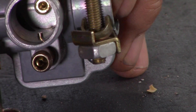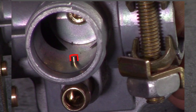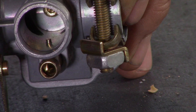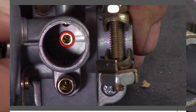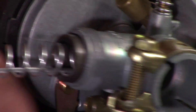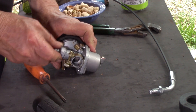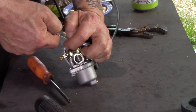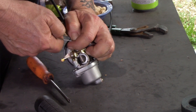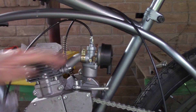Take note of the gas inlet tube on the carburetor. Looking inside, you can see a little pin — that pin registers against the groove cut into the slide. Looking deeper into the carb, you can see the jet highlighted in red: the needle goes into that hole, and the pin goes into the groove cut into the slide. Operate the cable and you can see the slide moving up and down — everything looks good, with the slide going most of the way down inside the carburetor.